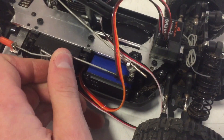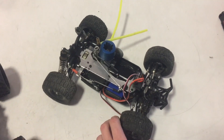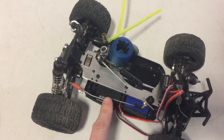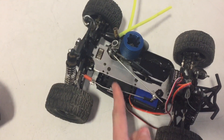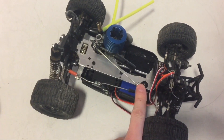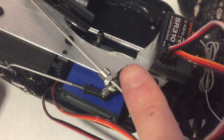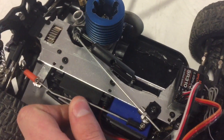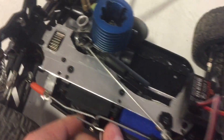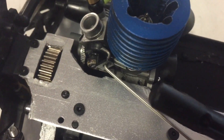The other direction, of course, is throttle. I had a problem because this engine is mounted facing backwards, so pointing towards the rear of the vehicle with the front, of course, being up here. I had to get the push rod to move in the same direction, but this angle of a rod going straight to the carburetor was too steep. So we just did a quick — it's actually a cut-off servo horn that hinges here — and movement from the servo equates into the same directional movement on the carburetor. A little spring added to the carburetor from the engine cooling head to keep the carburetor closed.